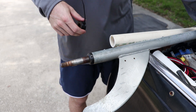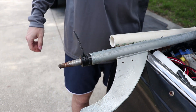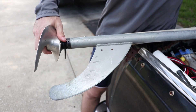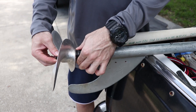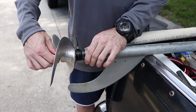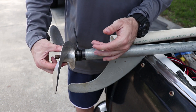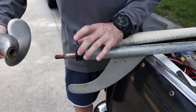So the first concept that works is this - the prop goes on, follow that keyway, and there's no space here for weeds to wrap around. This moves freely if you don't tighten it down all the way, but it's supposed to spin. Weeds can't collect here to block water flow. You need water to flow through there, so the whole goal objective is to stop weeds from collecting there to stop the water flow. We want water flow, we want to stop the weeds collecting. So this was fix number one.